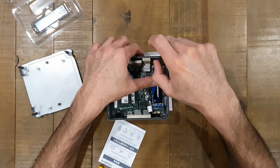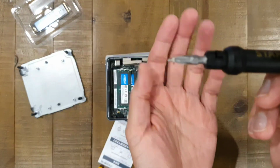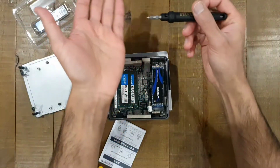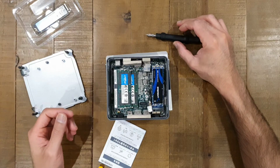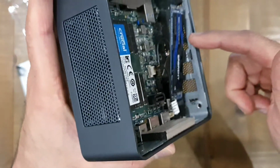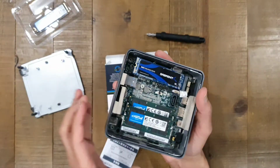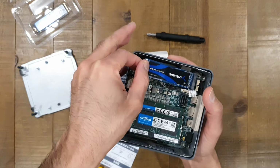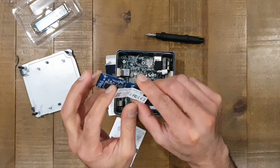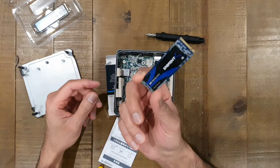And once you unscrew it, there's a screw there. As you can see, it's an extremely short threaded screw. You may or may not be able to even focus on that because it's so small. There it is. Just be very careful not to lose that because you'll have a problem otherwise. What you'll notice is the drive actually just pops up. So if I turn it to the side a little bit, you can see that there, it pops up itself. So that's normal. It comes up into a nice position, and all you've got to do is literally just grab it and slide it out just like that. Now, you can see these things get very hot, and you can see the label has actually come away from the unit there. So that's the end of that.